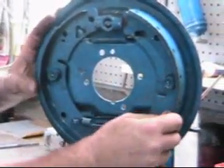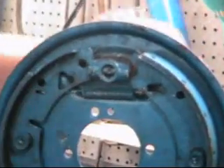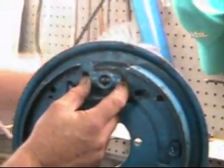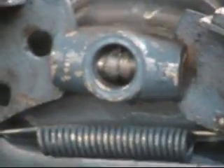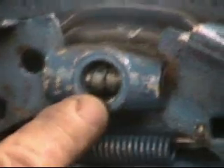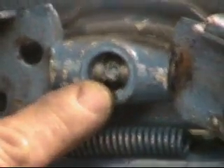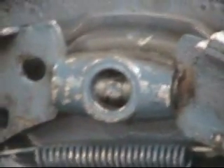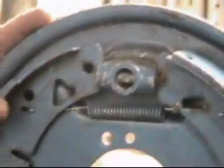Now we've got to deal with the adjustment. To deal with the adjustment, we need a quarter-inch four-point socket. We take our adjuster and adjust it all the way back so that the little conical pieces in here come all the way together. Make sure your handbrake is all the way off. Now we can adjust the brakes by moving this quarter turn by quarter turn until the drum locks up and you can no longer turn the adjuster. Don't break it off, but get it nice and tight. Then back it off quarter turn by quarter turn until the drum just runs free. Theoretically the distance between fully locked and fully free is one quarter turn, but in practice it's usually two or three.